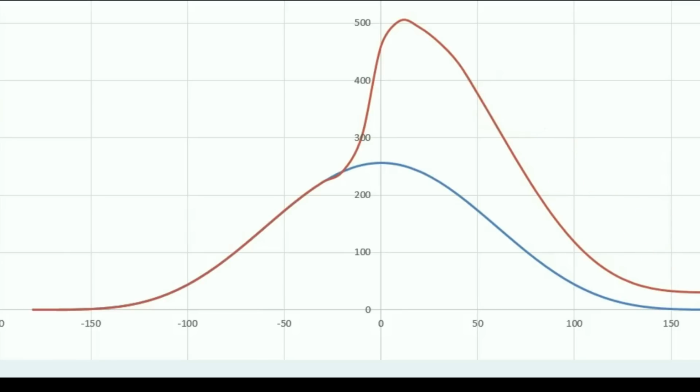This is the point where the exhaust valve opens, by the way. So most of that pressure, most of that air-fuel mixture is then igniting when the exhaust valve is open. So you're actually throwing all that burning air-fuel mixture out of the exhaust. It causes some spectacular flames coming out of the exhaust, but it doesn't really give you any extra power.